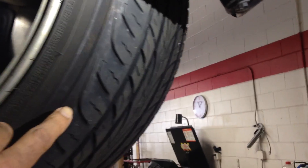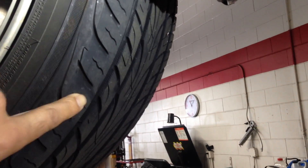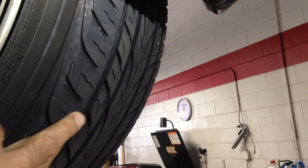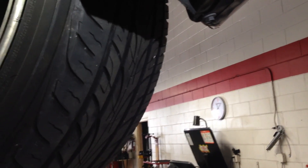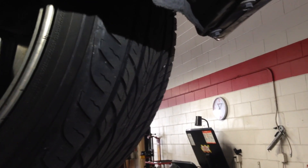This is the inside of that vehicle which concerns us. You can see the wear right here is chamfered off, so this car needs an alignment to have the camber adjusted and the toe adjusted — that's the wear and tear we're trying to avoid. This is why these models, the G35 and the 350Z, need camber adjustment kits to take care of this problem.